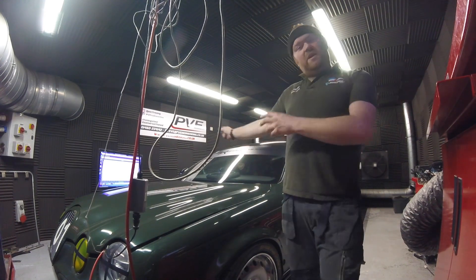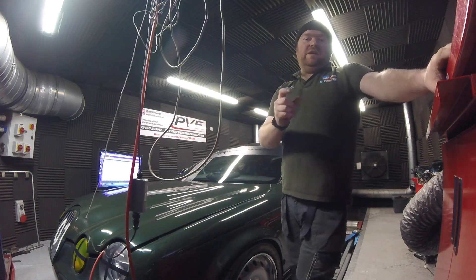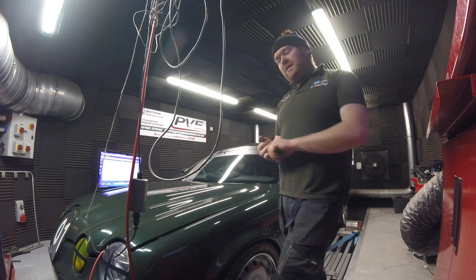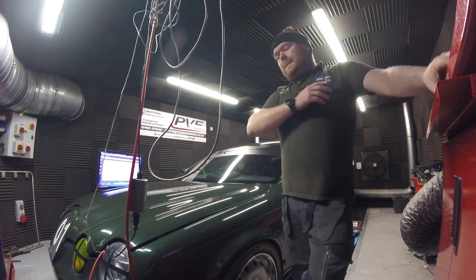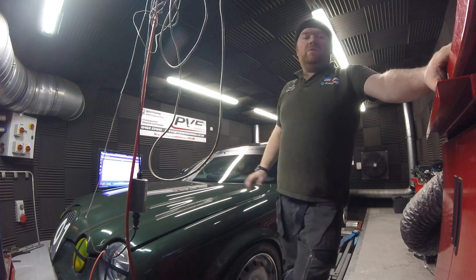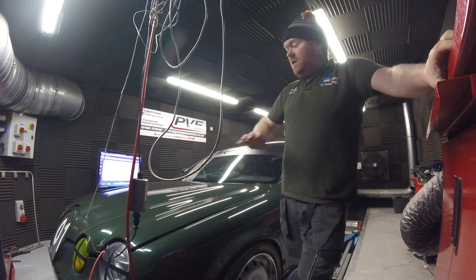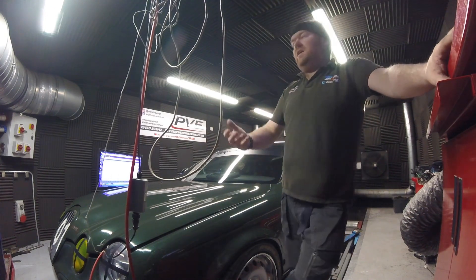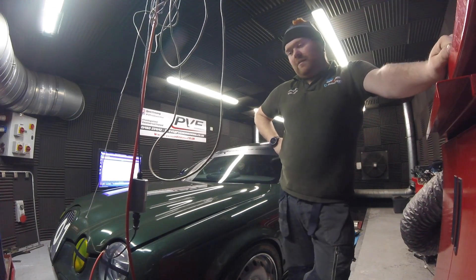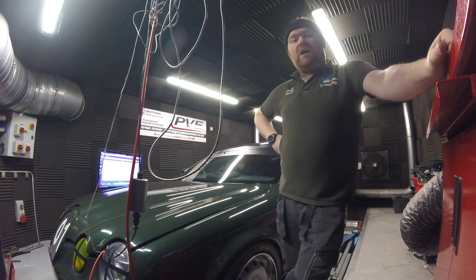We've even got an Android radio in the vehicle where we can look up the M-dash — the M-dash is like an app which comes from Max ECU. We can load it straight on and connect straight to the M-dash, so we can have various levels of limiter and various different tunes just by the flick of a switch. So we have now got a fully working example. We've still got some bits and pieces to finish up — we've got to actually integrate the traction control and those things, but we've picked up on them, we know where they are in the CAN bus, the ECU is reading them and giving us the speed output in the data log. We're really excited, getting closer and closer to being able to send one of these straight out the door as a working example, and this has been an absolute pleasure to use this actual car for.